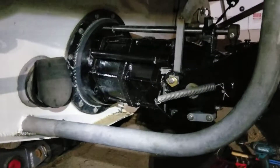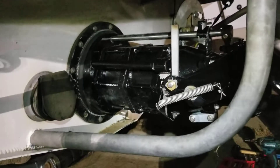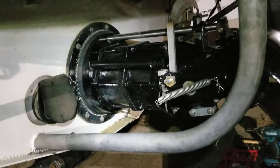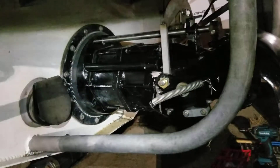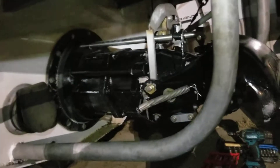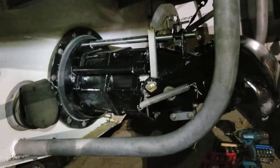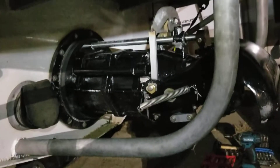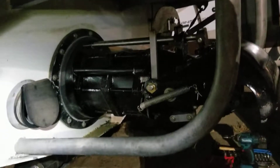Yeah, it's a good engine, good platform. The pump is a three-stage pump, which is kind of an older style — there are three stators and three impellers inside. What I have in there now is two 19-degree impellers for stage 1 and 2, and stage 3 is a 22-degree impeller. That's supposed to be what works with this motor, but these impellers are worn — they're slipping pretty bad. This thing has literally no hole shot at all. So I'm going to fix it.